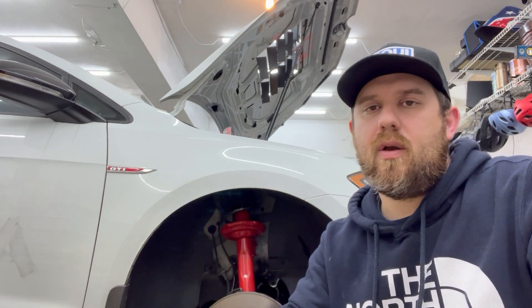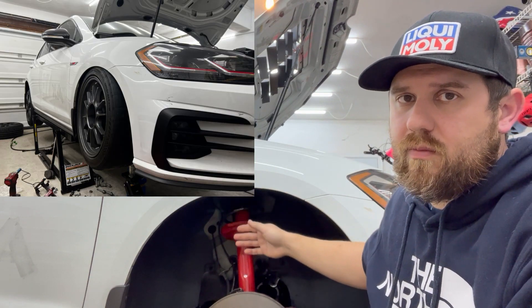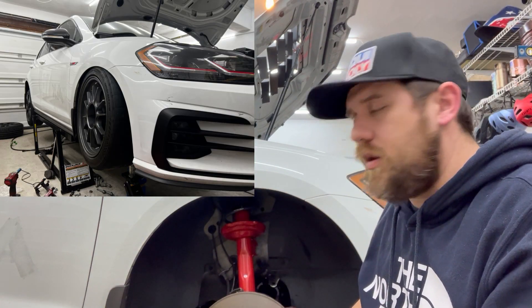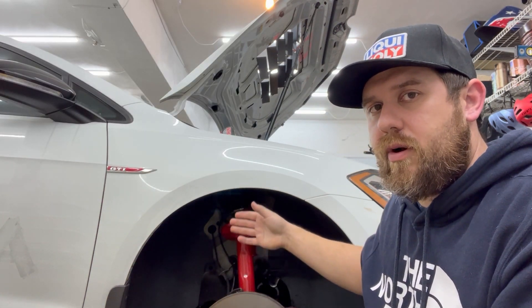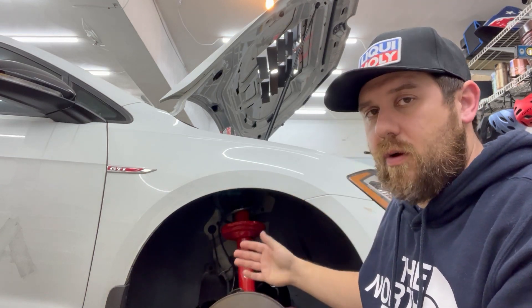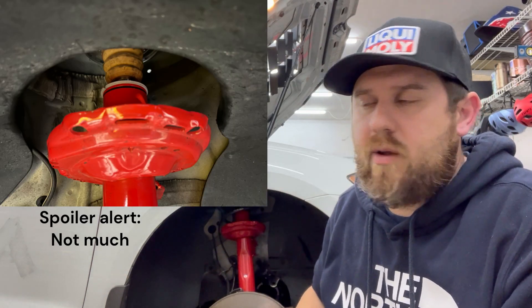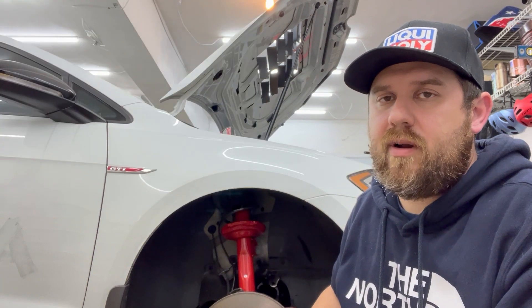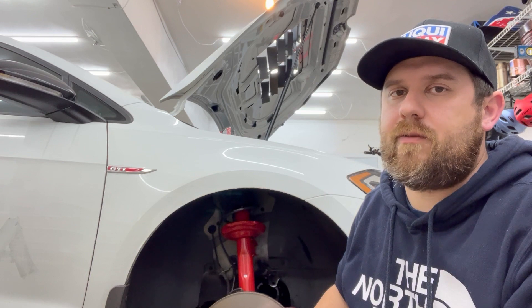The three things I looked at really heavily in depth while the car was apart were: one, ride height and shock travel — wheel travel. We have some questions: if you lower the car an inch, how much bump travel do you still have? If you don't lower the car an inch, what do you have to start with? Anyone who wants to modify their car to go faster is doing themselves a disservice if they're not baselining it in stock form first.